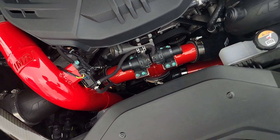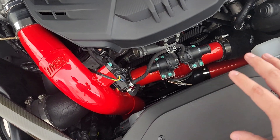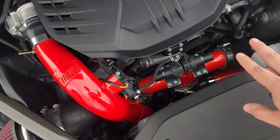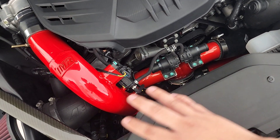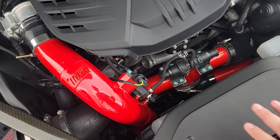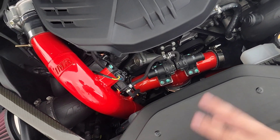The shop I used was Asian Motors. I had to leave the vehicle overnight, so I wasn't able to film the install. Some of the key things they mentioned was the tight fit — IMR also confirmed that because of the three-inch piping. One key note: before tightening all the clamps, go ahead and mock up the whole system. Make sure everything is clear — the intakes, the piping, the flange area — before even tightening. Preset the couplers, and once everything is clearing in all areas, then finalize and tighten the clamps.